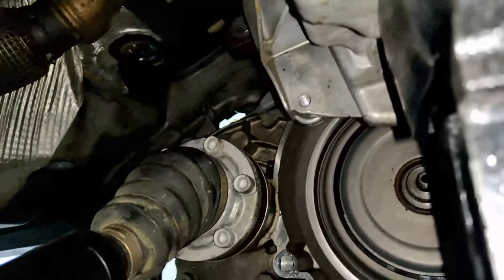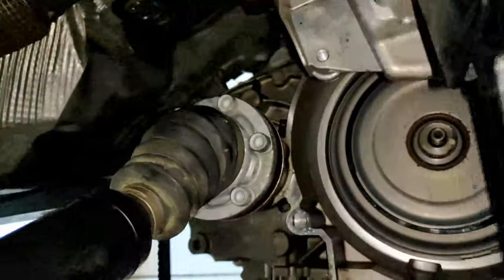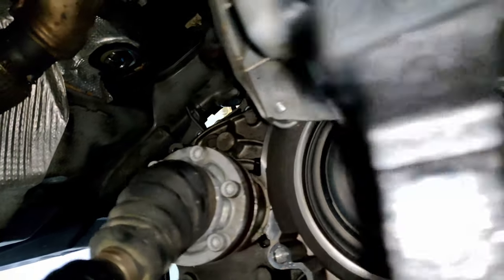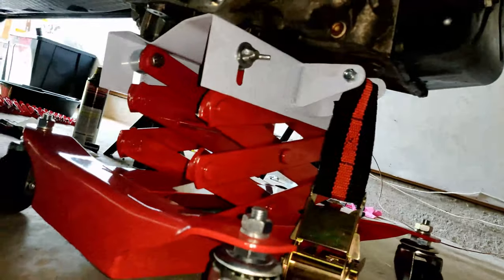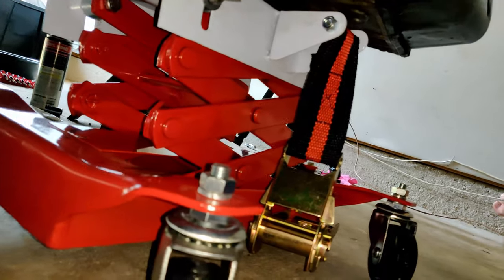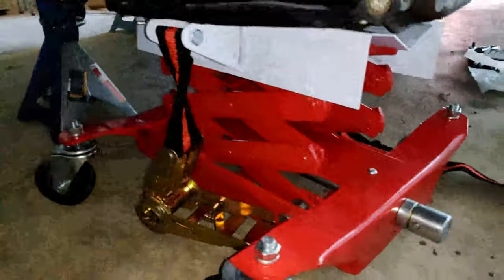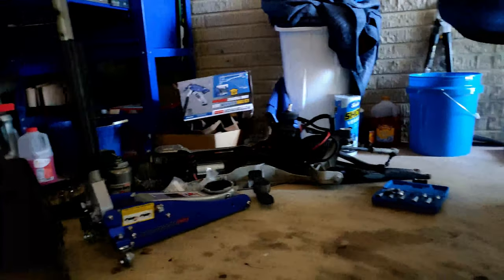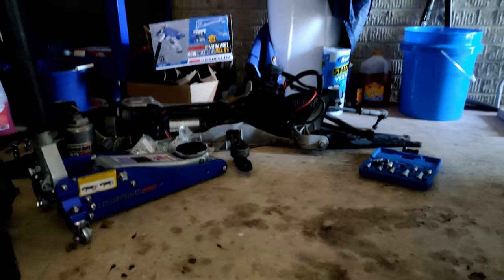You can take that piece off to lift around the obstacle, but you'll probably also need to remove the little crown piece. I'm just going to lift it slightly behind and then move it forward as I fasten it. The strap for the 450-pound transmission jack from Harbor Freight worked out really well. It keeps things a lot more balanced than my regular jack, though it takes a lot of manual effort since it's not hydraulic. I'll probably use the hydraulic jack for the steering rack since it's much lighter.